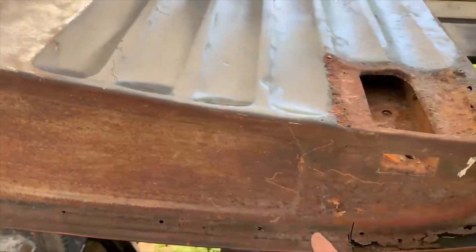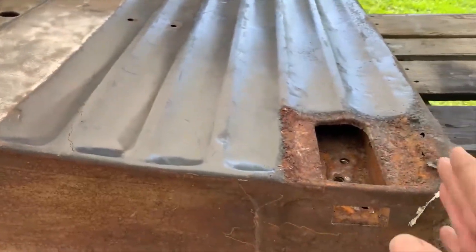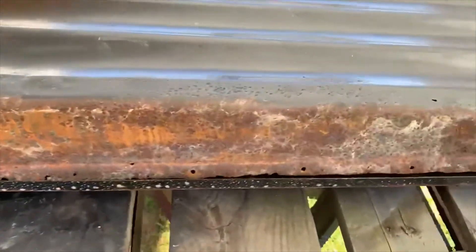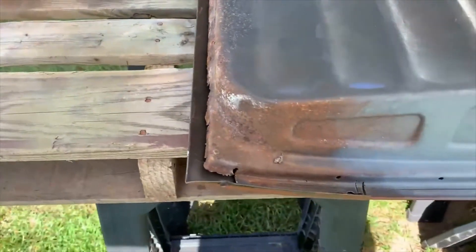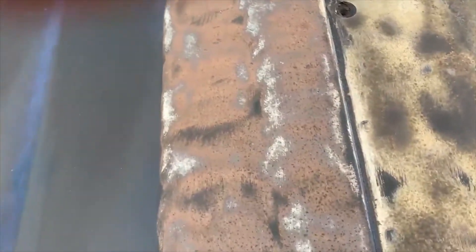Right here, we're going to come along in here, zip all this line clear across there, and take all that out of the way. You can see there's a lot of cancer — you don't want that when you're doing door work. You try to weld on that and it just goes through it like a hot knife through butter. Anyway, we're going to strip the door down like this and get it to bare metal because we want a nice finish on it.